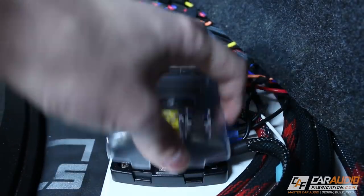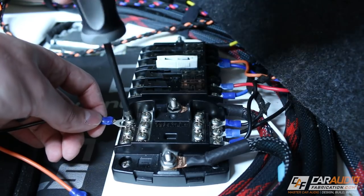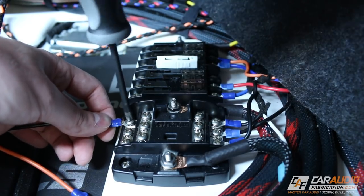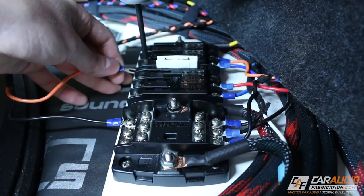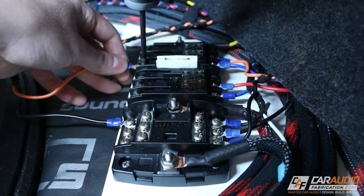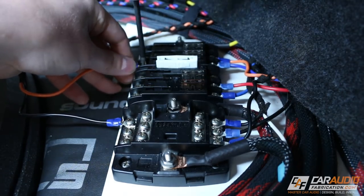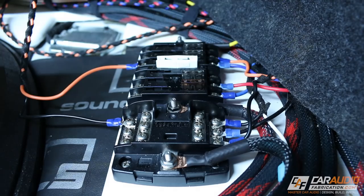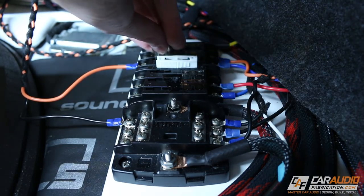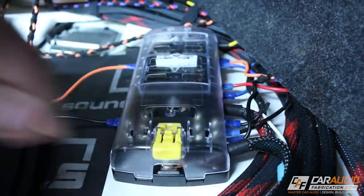Now, over in the vehicle, I can connect my wiring. Now, understand with this fuse block, I have, of course, ground, but then I have two different sides of positive feed. One of the positives is a constant, and the other one is switched, and it comes on with the ignition of the vehicle via a relay. So I'm attaching these LEDs so that they turn on only when my sound system is on. I then add a properly sized fuse, and I secure the fuse panel cover back on top,